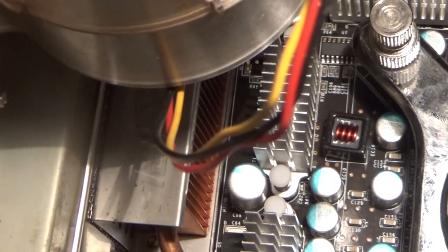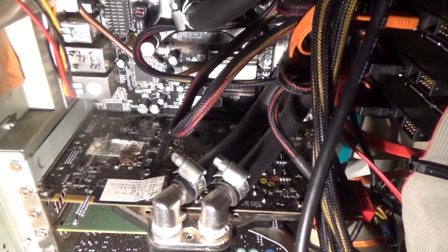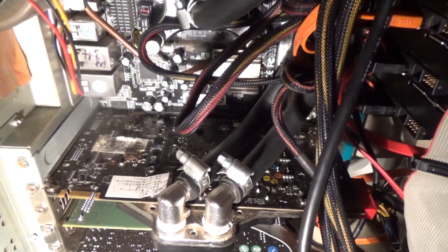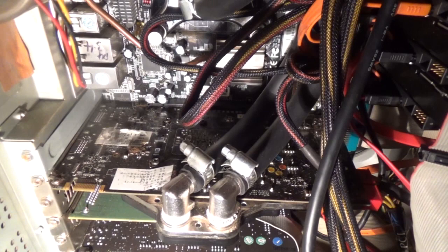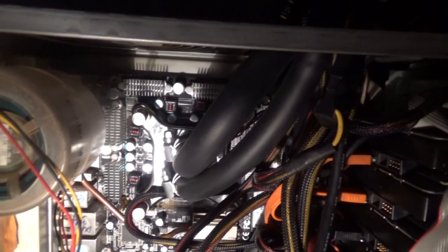You'll almost never see the AW8 in comparative benchmark charts against other boards for one simple reason: the AW8 is by far the slowest of this group and was also very costly, largely due to these shitty copper heat pipes — a feature that will likely be the death of this motherboard eventually. Interestingly A-Bit did actually make a water cooling block for this board. I even remember seeing it at the time; it was quite expensive. Because today there's no logical reason to own any of these boards — they're all quite hard to find — there are good 945P and 955X boards in general, and any board that can be found more easily and cheaply would probably do just fine. Although if you do have a PF5 that you want to sell, I might be interested.